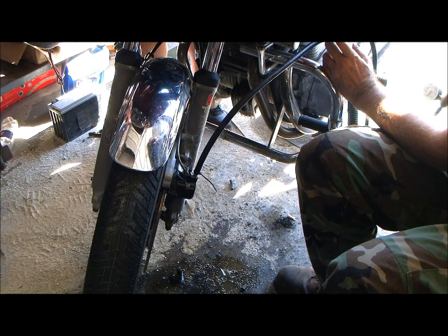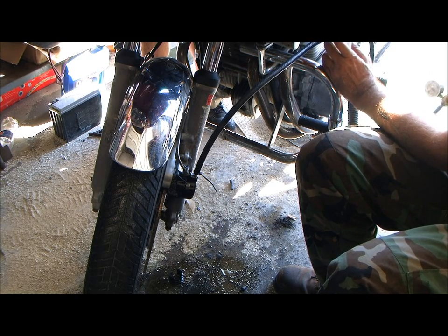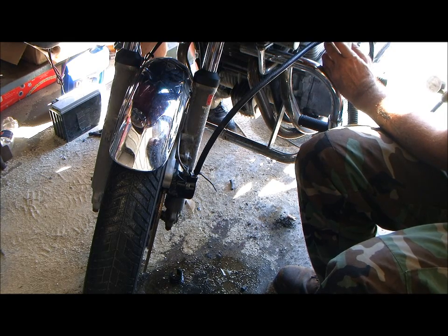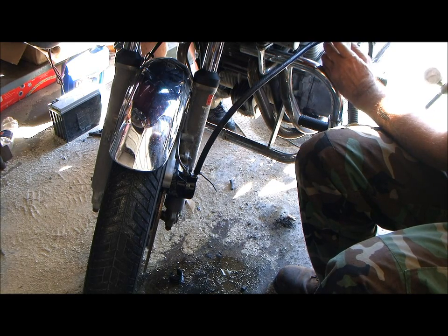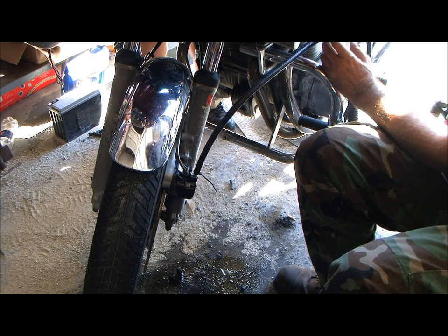Can you tell, is the return open already or not? Yep. I could tell that with my C-clamp. I clamped your brake, I have already had your brake off. So the piston works just fine? Yep. And I've already cleaned it, because that was my first suspicion. I thought the piston was frozen. Nope, it's always the return passage. Hondas and BMWs. It's always a damn return passage.